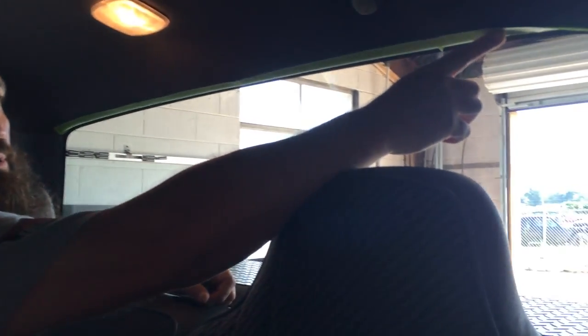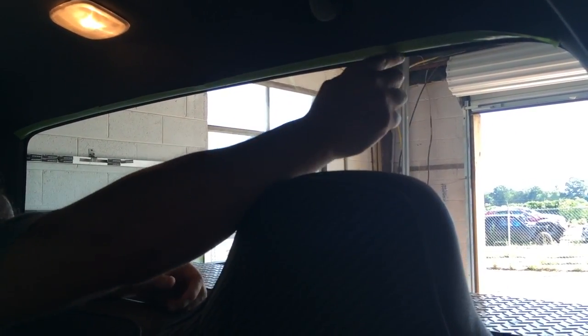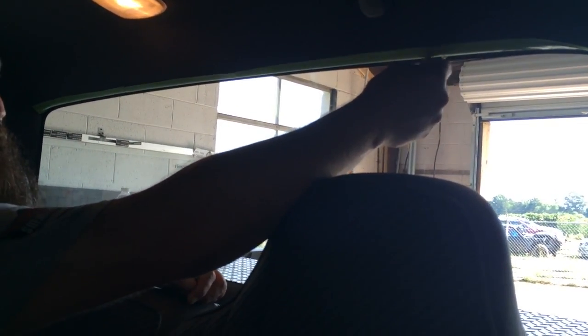If you notice, there's tape across the top here. This headliner's actually been replaced, but even if it hadn't been — these Dodge Rams are notorious for headliners going bad — you still want to take this off whether it's been replaced or not. If it hasn't been replaced, tape it. You don't want to get this wet because that'll actually make the headliner start coming back off when it gets wet. Same thing with the front right here — you can tape these.